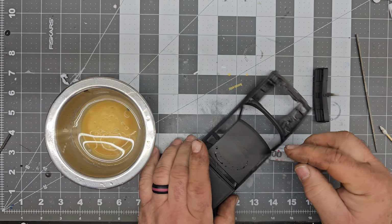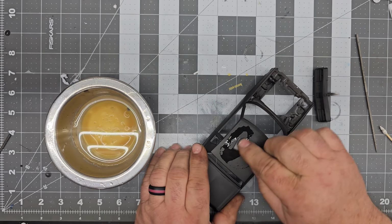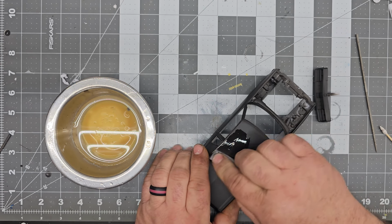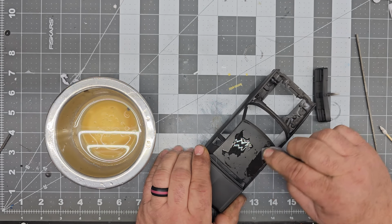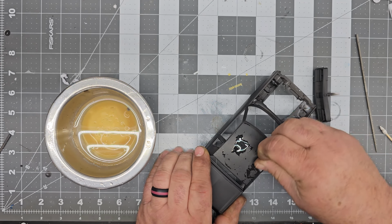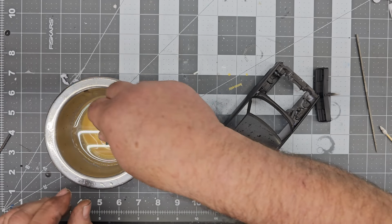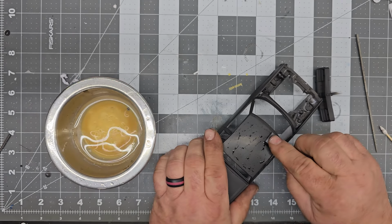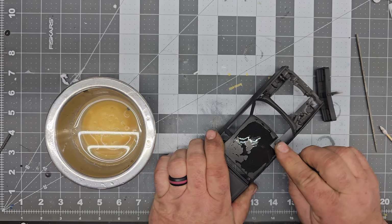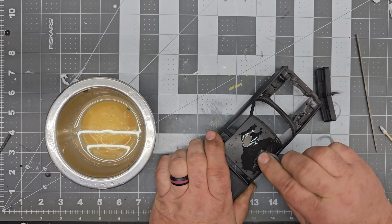Yeah, and like I say, definitely, as always, guys, make sure you stay away from those corners. Now, the primer, I'm not overly worried about, because we're going to put the lacquer on this. See right here? Scratch that so I can feel that. Unfortunately, I'm going to have to take that down a ways. But I can't just take that down because you're going to see a little bit of dimple there. So I'm going to have to walk the rest of it down around it, just so you don't see that. You just kind of walk it out a little bit out here. So we're going to get this kind of down where we've got to have it.